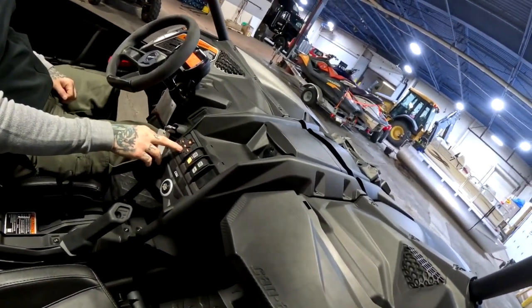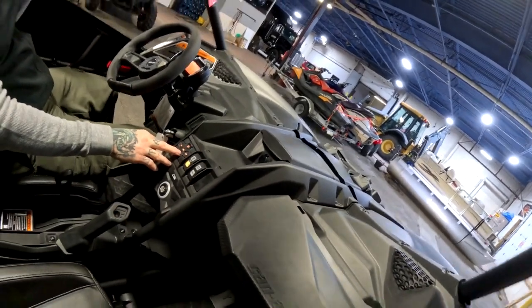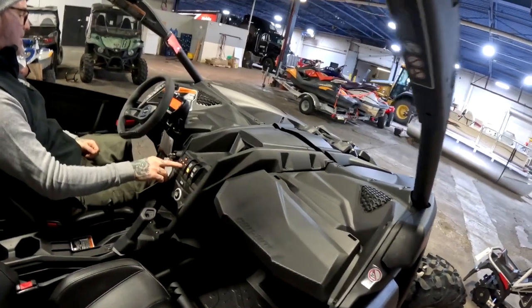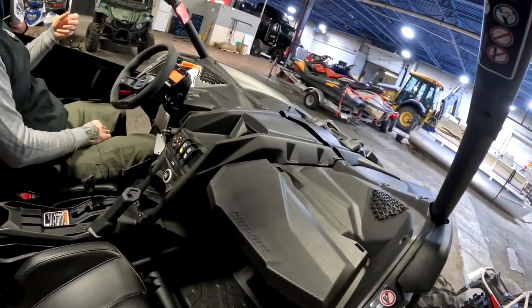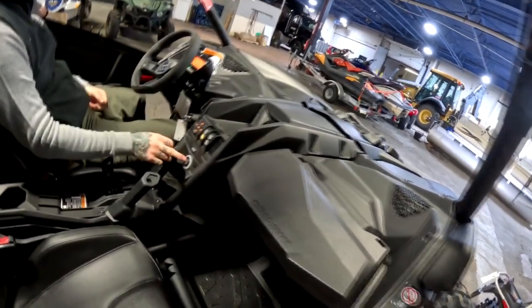DPS minimum, DPS medium, DPS max. The faster you're going, the less power steering you want. When you're road riding, have your power steering at minimum, because if you have it set too high, that's when you oversteer and over-rotate. The slower you're going, the better. Anytime you're doing